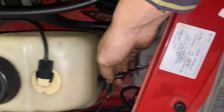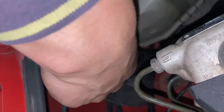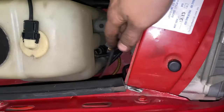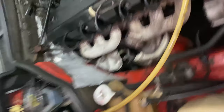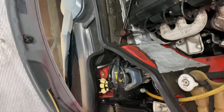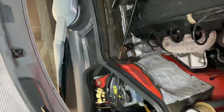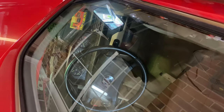The headlight tilters still don't fully work because I bypassed one end where the plastic nipple broke off the cover - that's an annoying common fault. So if you're having the same dramas: if your locking works because it runs off a separate vacuum circuit, but your economy gauge, headrests, and tilters don't work - they're all on the same pneumatic circuit. My tilters still don't work - I think there's some pressure equalization that has to happen - but my economy gauge now works.